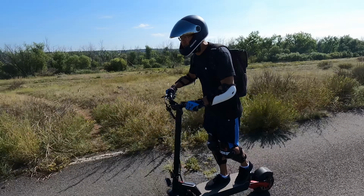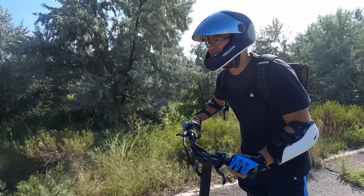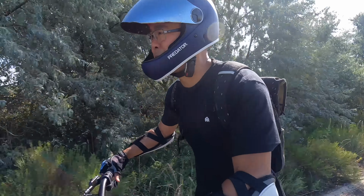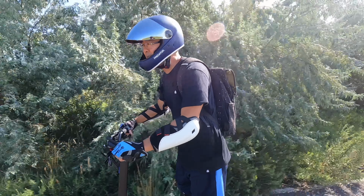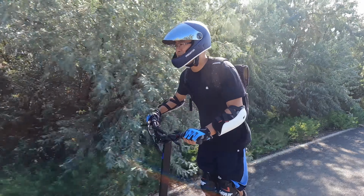Oh yeah, you gotta remember, they swapped the left and right for the front and rear brakes on you. The brakes work well, but you gotta remember that, otherwise you're going over the handlebars. If you rely on just the rear brakes and you're gonna mash down on those and they end up being your front brakes, that could be disastrous.